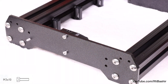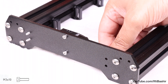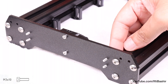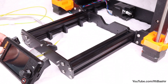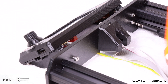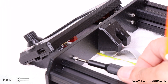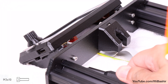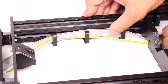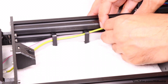We're ready to get this installed onto the printer frame. Insert four M3x10 screws through each of the available holes from the inner side. Guiding the LCD and PE cables under the plate, bring the LCD assembly towards the frame and secure using the four inserted screws, going straight into the side brackets with the square nuts we pre-installed earlier, until nice and snug. With that secure, guide both cables through the cable clips on the inside of the frame and back towards the electronics box.